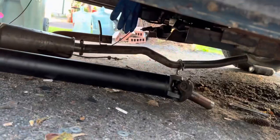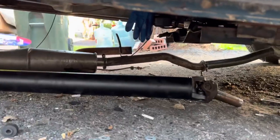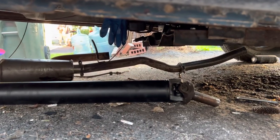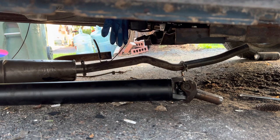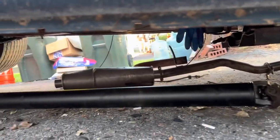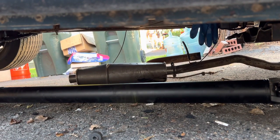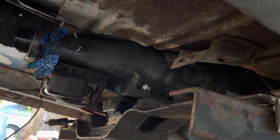Now since the carburetor is being worked on, I'll go ahead and finish up the driveshaft. Here's the new one — if anybody's interested I can post the measurements, but check with your local shop and make sure they give you the measurements they want. In this case they wanted the front yoke pressed all the way into the trans so they can compensate for the seven-eighths or inch of play. If I remember correctly it was 53 and one-eighth inch from the flange seated in the transmission all the way to the center of the tail. Let me climb underneath and get the front of this in.